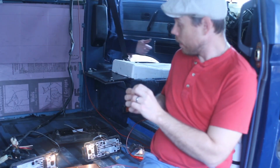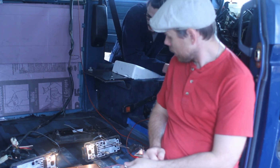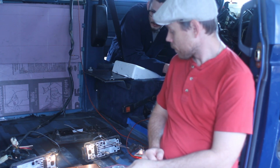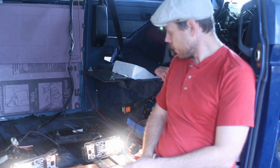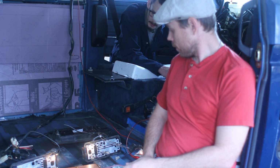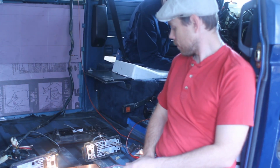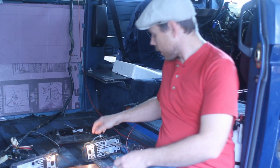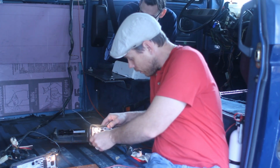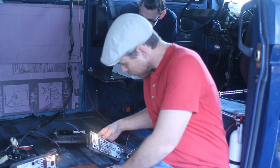So, what cable would I have removed to trigger the reverse? I don't know. We'll have to figure that out. That's brake. Brake. This is light in general. That's left. That's right. We can't make the right work for some reason. Do we have power going to that bulb? So the bulb has continuity. Pull the bulb out and shove the power sticks into that bulb hole.